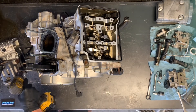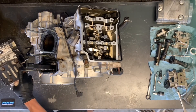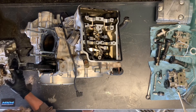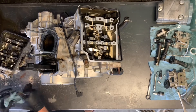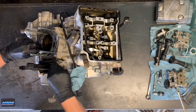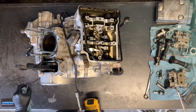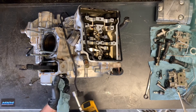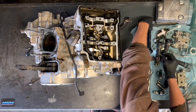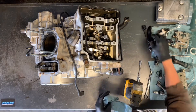The exhaust manifold uses 12-millimeter bolts. A lot of times these get pretty rusty. That exhaust manifold and its shield are ready to pull off — we'll put that with the rear stuff. We've got our cylinder head here with four valves — two exhausts and two intakes. Make sure we keep track of all those cylinder head nuts; I'll set this aside and let the head drain the oil. We've got our cylinder head gasket here — remove that. There's also a guide that takes a 10-millimeter specialty bolt and has an O-ring to seal it, so be careful when removing it. Set this with the rear cylinder parts.